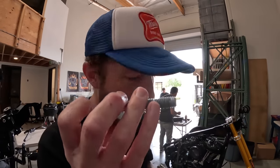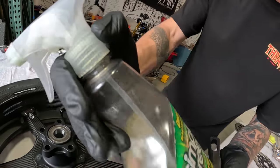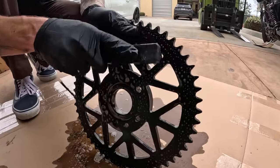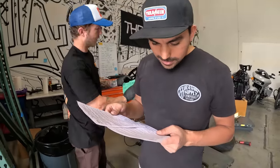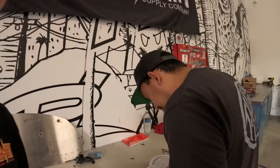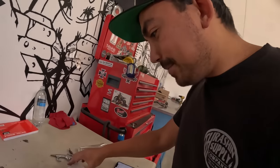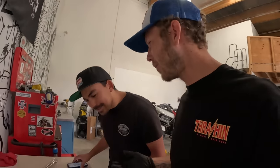We're no longer using these — going to titanium bolts, easily half the weight. The torque spec says 40 newton meters on the sprocket carrier. I was going to look it up but it's the same bolt as the Dyna so I'll just use that torque. It's going into a billet hub which is probably stronger than the cast one, but if it works there's no need to over-tighten. Dual disc screws 16 to 24 — you said 25, you'll be all right.